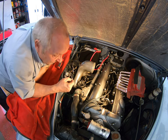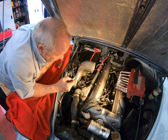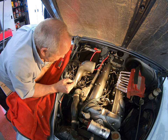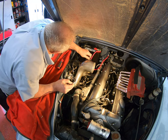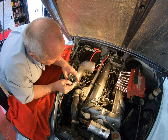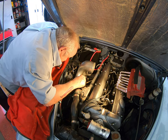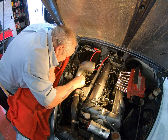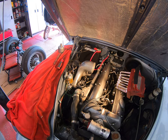This one's got an 'F' on it for front - so already these are in the wrong place. Now does it make a difference? It can, because they've bedded in over the years. So this one with the F should obviously be in the front carburettor, and the one with the R should be in the rear. I am going to swap them around and put them back where they should be - assuming the person who marked them did it correctly in the first place. What's wrong with this one? Oh my god, that needle is in wrong. That's certainly something I want to fix - put it in there and leave it safe until I can get these carbs off.